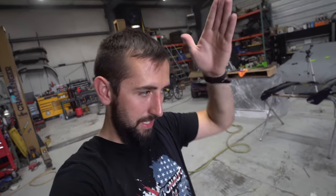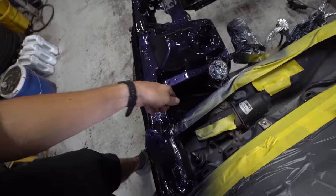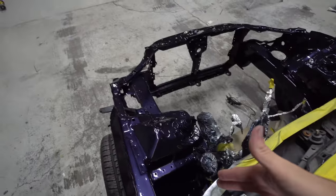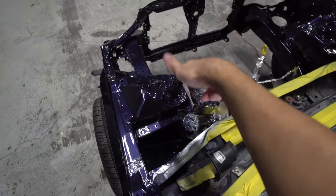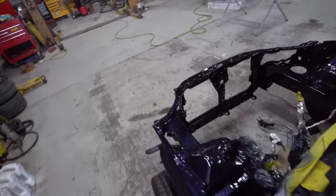One of the things I did want to say though is, when you are painting your bay, you don't have to leave the paint gun in the fan pattern. You could turn the dial down a little bit to where it's a cone, so it shoots out more like a fire hose, almost like a rattle can, and that works out really good. When you're painting these areas in the back, you could just point it down there in the hole and fire hose some stuff on it.